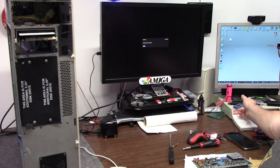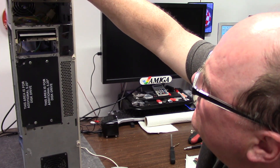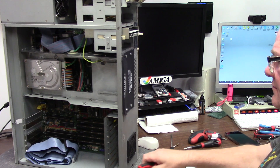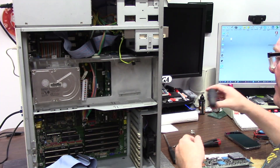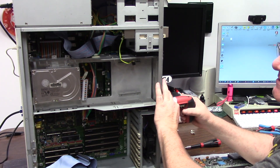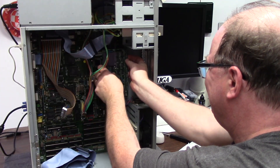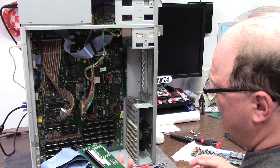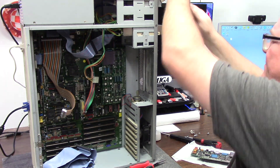All right, I don't know if it's going to work or not. Who knows. Now we're on — energize. Stuck in low. It is not working. I'm going to do the impossible and take this hard drive tray out. I hate doing that but a powered screwdriver, four screws and a yank makes it a lot easier. Pull this off again just to make sure everything's cool. Everything's cool. Maybe I didn't have it in all the way. It is in. Still stuck in low. This 3640 does not work.